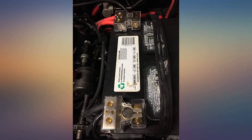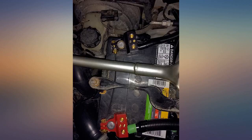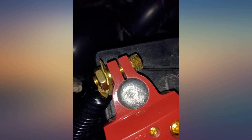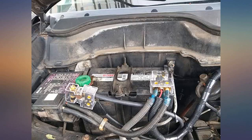Twice as loud as before, bass no longer sounds distorted. Good battery terminals. Battery post shims are provided for both positive and negative sides, and also include sleeves for wire sizes under 2 AWG. As I'm using 4 AWG and 8 AWG wires, I use the sleeves. Wires are held with 3mm and 5mm hex bolts.